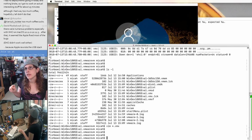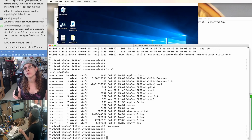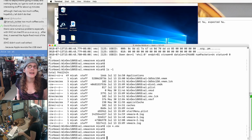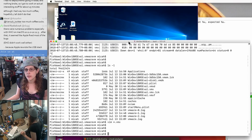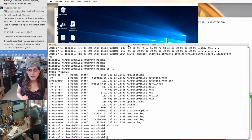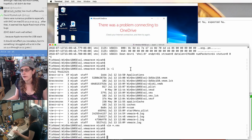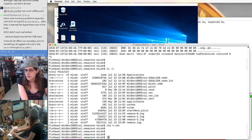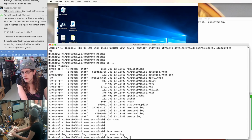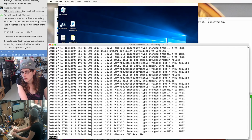So to be clear, I'm using the host's USB controller in USB 2 high-speed mode, but telling the guest that it's actually a super speed device and connecting it to XHCI. Lying about the speed, but using XHCI as the controller. It might not work because of the way the isochronous frames are calculated. An isochronous device is the least likely to work out of anything, but I thought it would be worth trying this out since EHCI was not working super well. I could also try tweaking some EHCI parameters, but that's probably not gonna help.